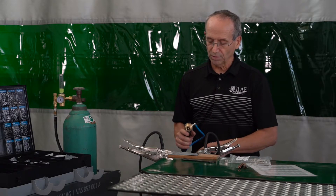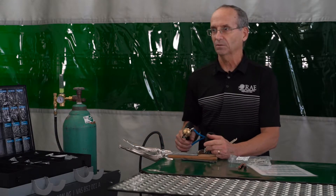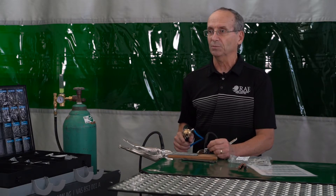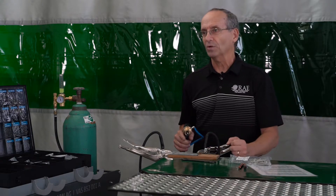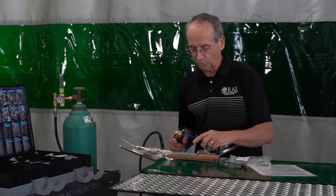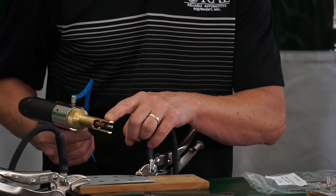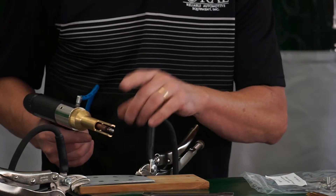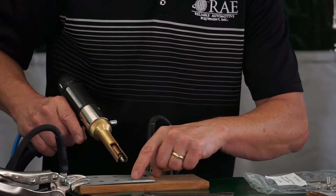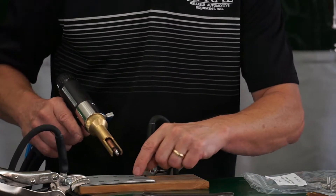Because we are doing stainless steel on top of stainless steel, we use gas. When welding a regular steel stud as a replacement to the vehicle, the chart shows no gas on a regular steel stud — but on stainless steel, it does require gas, so this will throw a couple of sparks. The nose cone is also different: instead of being a big round one, this design allows you to get into a tighter area, which is necessary because you need to place the end of the stud directly on the head of the rivet — with the big round nose cone, you would never be able to find that perfectly.